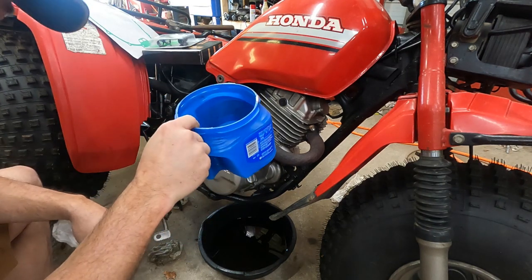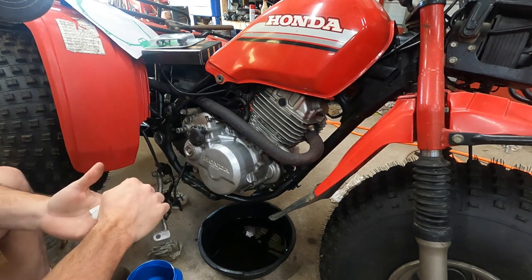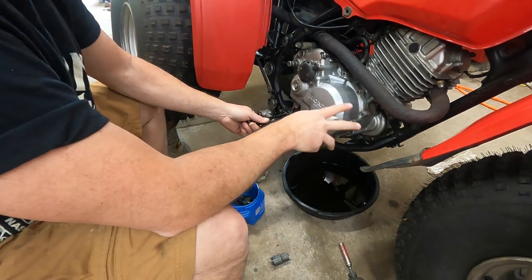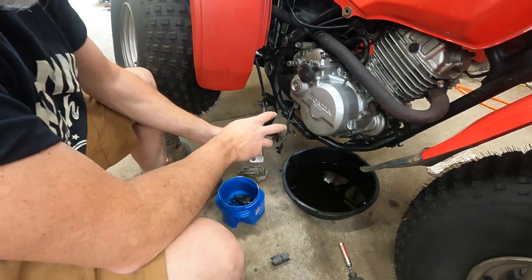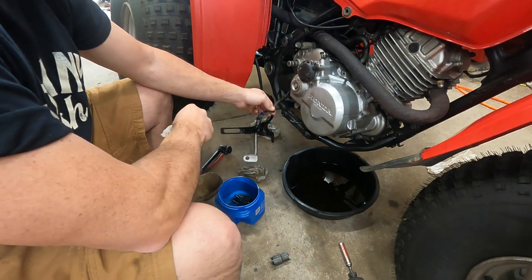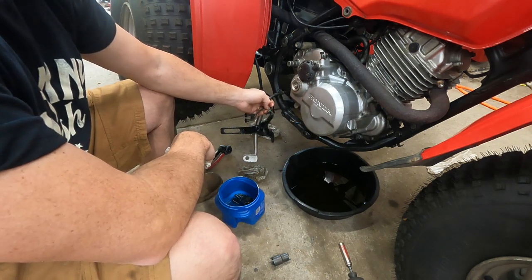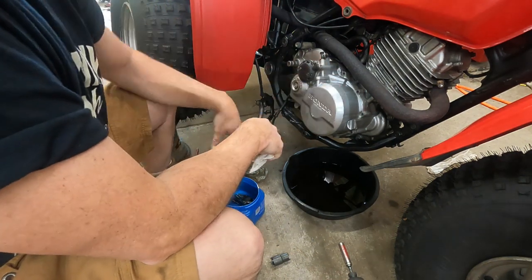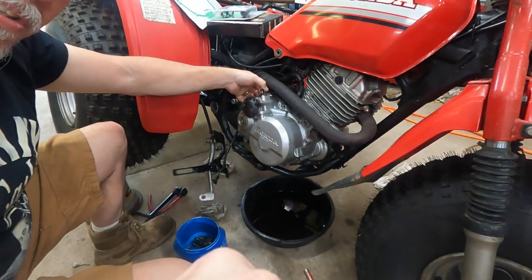I take all the bolts and put them in the bucket — that's how I keep everything straight between the bikes. On the 85, 86, and 87, I take this assembly off on the two bolts. No point taking the pedal off and all that. Two bolts, pull the whole assembly out and drop it back out of the way. You've got two electrical components — hookups for your reverse and your neutral start. You can just unplug those from the case. There are two bullet connectors and then one plug. That pretty much frees up the outer cover of the case. You've also got your oil feed line at the top of the case — be sure and disconnect that as well.